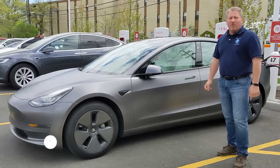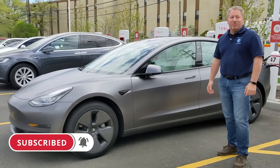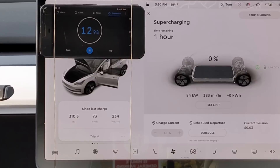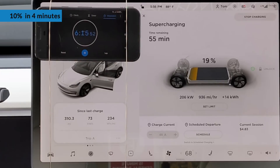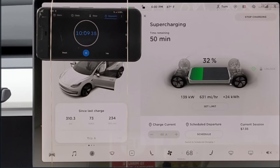Before we jump over and watch the whole recording, please click that subscribe button and tap the notification bell so you don't miss any upcoming content here on State of Charge. The charge rate started off at 90 kilowatts and didn't reach the full 250-kilowatt power until the four-minute mark when the battery was at 9%. It only held 250 kilowatts for about a minute and a half until the state of charge hit 17%, and then began a steady ramp down until the car was at 30% state of charge, where the charge rate leveled off at 139 kilowatts.